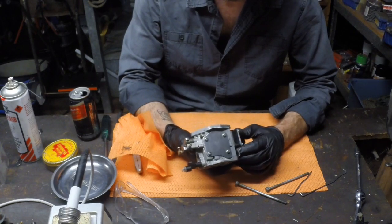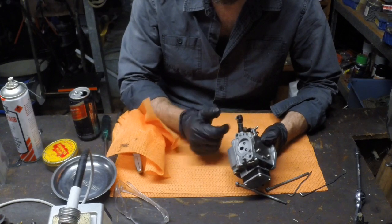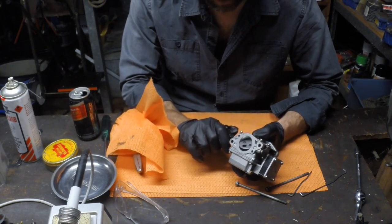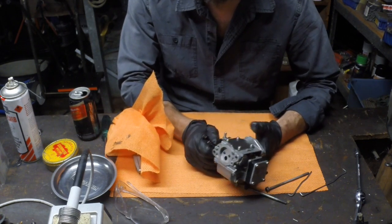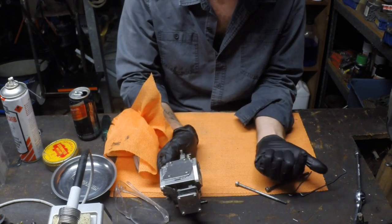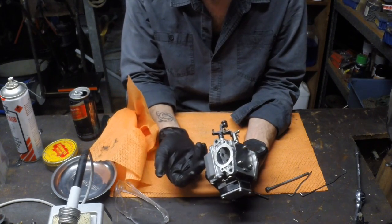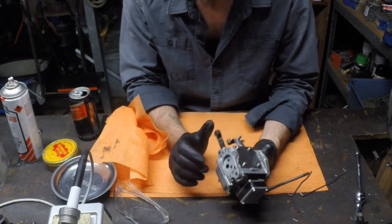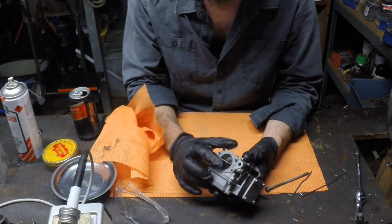Now the carburettor itself has, I guess what you'd consider, a front and a back. So the front is where this choke plate is. This is a video on cleaning rather than carburettor theory too much, but the idea with a choke plate is it really increases the vacuum, so the engine, through its induction cycles, is drawing air through. So instead of a straight venturi as the air comes across, you choke it off and then it'll suck fuel directly through. So it's a way of getting a very rich mixture which you use when you're starting it. So that's what the choke plate is.